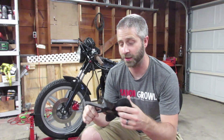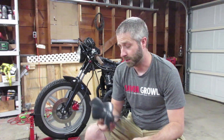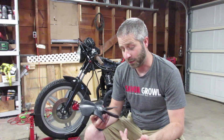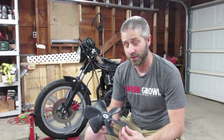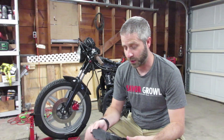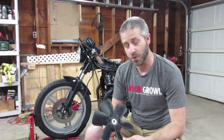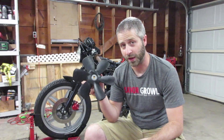After finding that the fan had been fairly damaged and is basically unusable and a complete risk to reinstall into the bike, and finding out fortunately that my radiator seems to have gone undamaged — so really lucky there — I've learned that I can do an electric fan mod to this bike, which removes the need for this mechanical fan and actually seems to provide better cooling power.